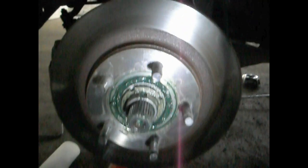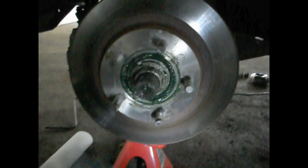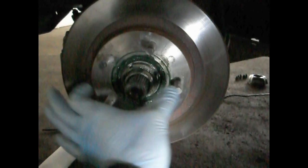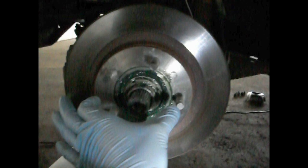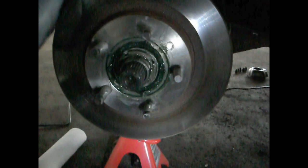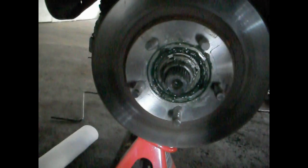Then, once you're done with that step, you need to loosen that inner lock nut only a 1/4 turn. So let's say this is top and bottom, you need to move them like that. Now when you go to loosen him a 1/4 turn, you're supposed to rotate the rotor and hub this way. So as you loosen up this nut, you turn him this way. Then once you're down to a 1/4 turn backwards, you're supposed to use a really small torque wrench.